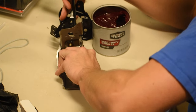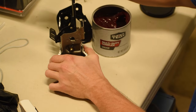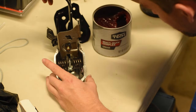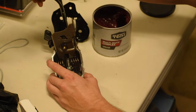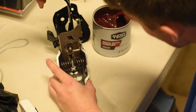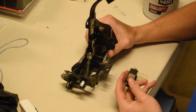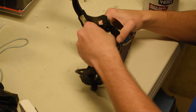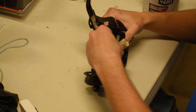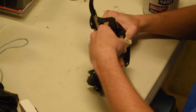Then I had to take the middle piece and bend it back down into the actual clutch pedal interface — this is kind of the hardest part of putting the pedal back together. You have to push with quite a bit of force, but once it's in, the pedal pretty much just snaps right back into place. Just push on the front of the spring and the pedal will snap back to its down position and accept the spring back into its housing. The clutch pedal is now fully rebuilt — with the bearings fixed and replaced, the spring is no longer scraping against metal, and that is going to solve the sound we've been hearing.